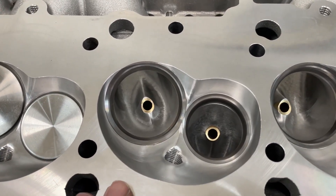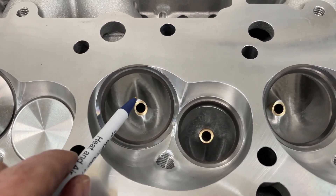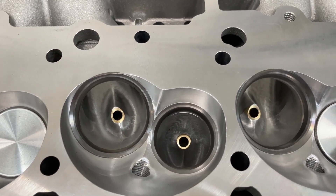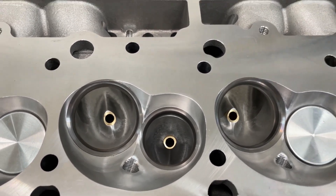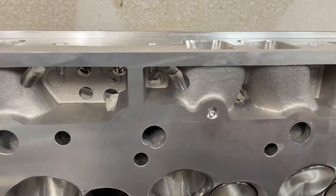I measured the ports themselves. The throat comes in at 90.6%, the bowl at 97%, and the pushrod pinch was 3.52 the way I measured. I did not remove the valve when measuring the throat diameters. Anyway, there are your percentages — let me give you a quick look around the rest of this head because it is pretty nice. You can tell it's fully CNC'd.